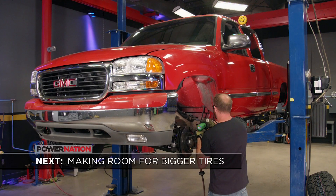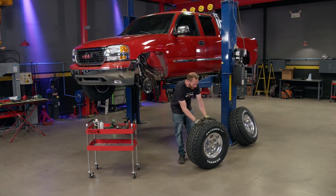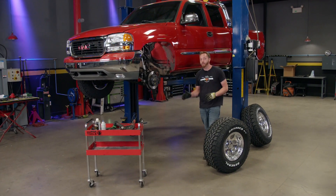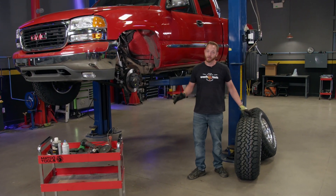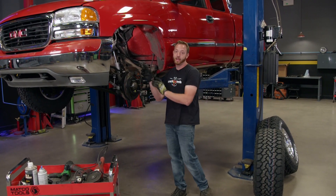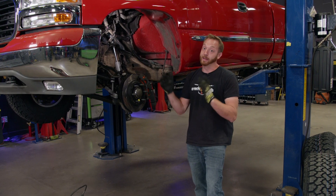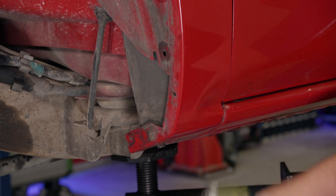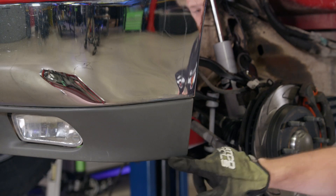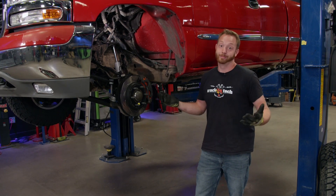A little trim for new rubber. We've got both the steering and the suspension systems taken care of on our retro GMC build, so we're almost ready to throw on the larger wheels and tires. But with this mild lift that we've installed, they're not going to fit right away without a little modification of the fenders. The stock wheels have a very high positive offset and a narrow tire, which means they're sucked up underneath the fender wells. Our new wheels have a high negative offset, which means they're pushed further out, and on top of that, they have a tall and wide tire. There are two areas that are going to interfere: number one is the back of the fender at the lower rocker, and number two is up front on the lower splash guard and a little bit of the bumper. Trimming is a standard practice when fitting larger wheels and tires onto an older truck, so let's get to it and throw some sparks.